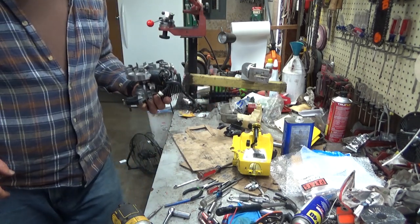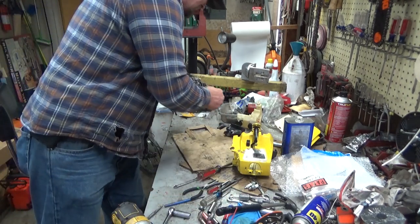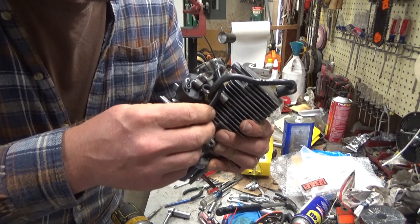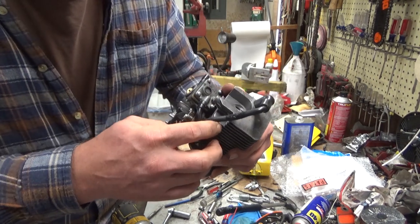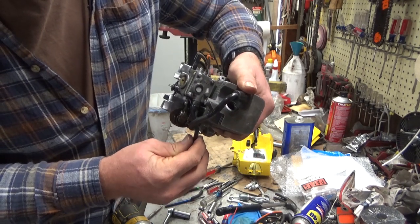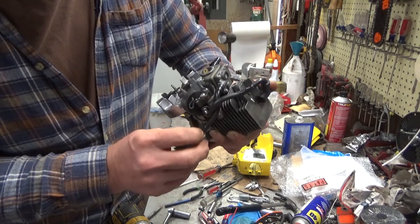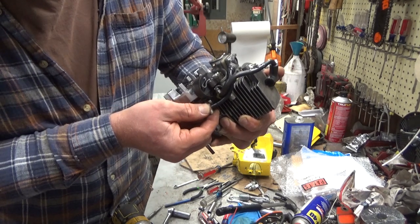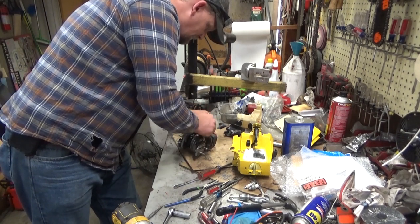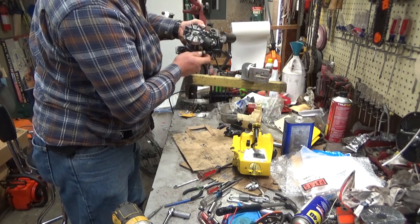Quick note, as you're getting ready to set this thing into the case, you want to get your spark plug the heck out of the way, of course, and you want the fuel hose routed like this, underneath, or I guess above, the spark plug. So as it sits in the engine, you want your fuel hose routed so that the spark plug wire comes up and around it, because you've got to get this indexed down into the engine case. So I'm going to actually turn this barb so that it basically faces downward. That's where you want it to be.